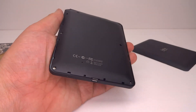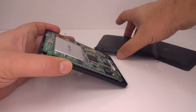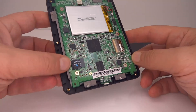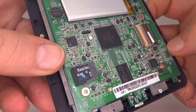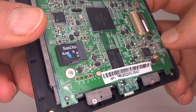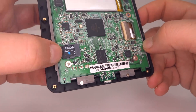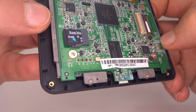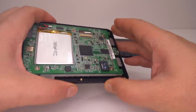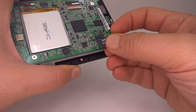We have some screws to do now, and we have the back off and the main board revealed. This is why I took it apart the first time — the Kobo Mini is a two gigabyte e-book reader, and I'd read that you can expand the memory by changing the SD card. When I opened it up, I found it already had a four gigabyte card partitioned to only two gigabytes. So I was simply able to take it out and repartition the card that was already in here to double its memory capacity.